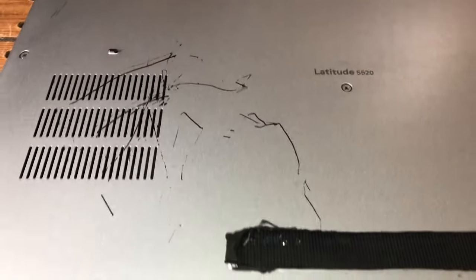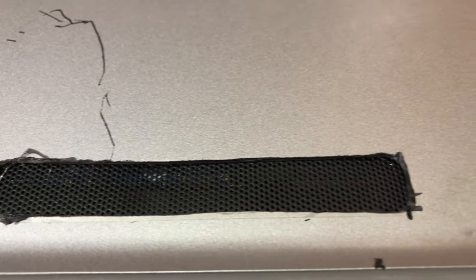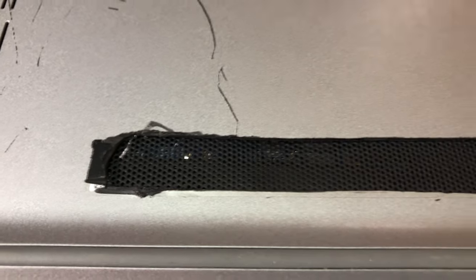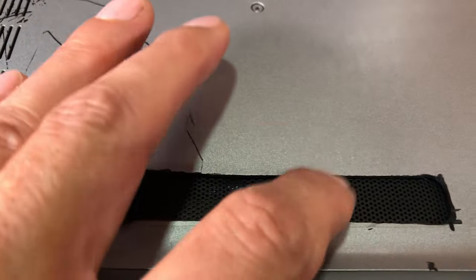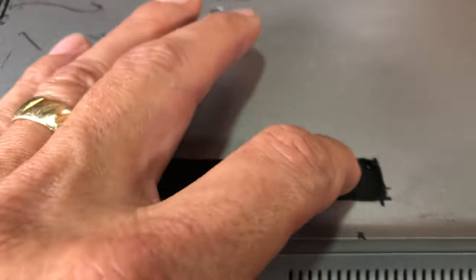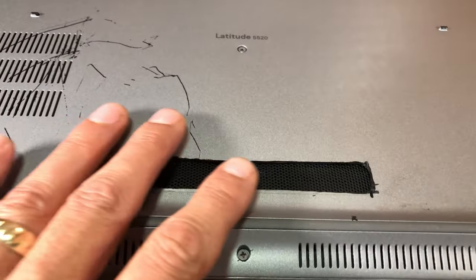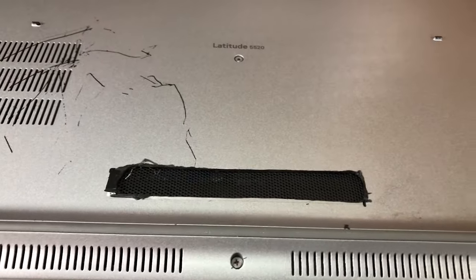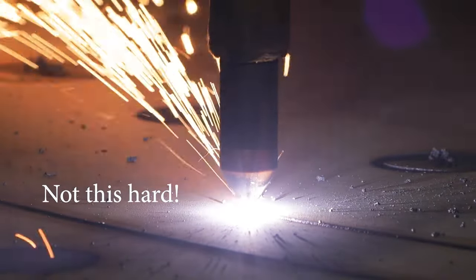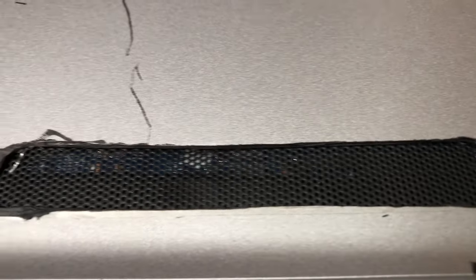So I cut this hole on the bottom over the hottest part of the heat pipes and installed a mesh screen. Stick around to the end to see the temps. I did this because my temps were constantly hitting 100 degrees Celsius and throttling the CPU during games. This was even after a cleaning and repaste of the liquid metal. It was a relatively easy cut, although I wasn't perfect overall. The mesh was simply hot glued right into place — I'll use something more permanent later.